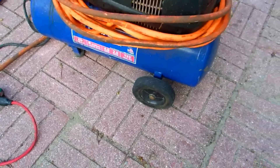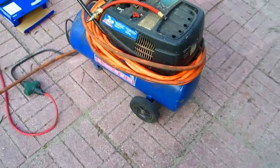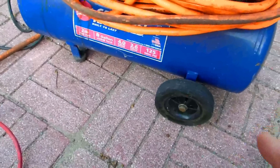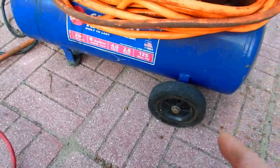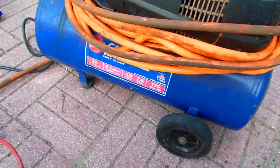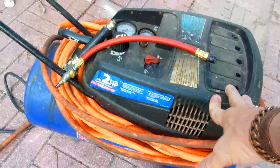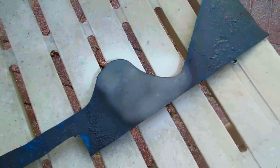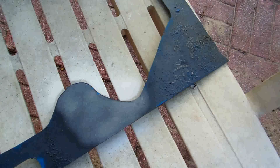With this current compressor at 2.6 CFM, that's about 28% of the recommended 9 CFM at 90 pounds. The 120-volt I'm getting has a 30-gallon tank, 5.6 CFM, and 155 max PSI. Look at that — nice clean surface. This crap is actually hard to grind off. It's some kind of coating they apply when you get a new piece of steel.